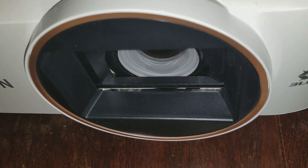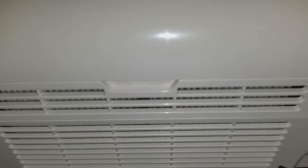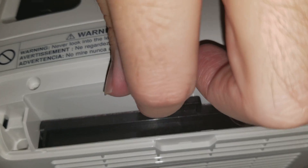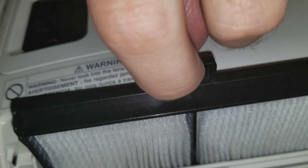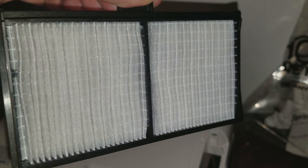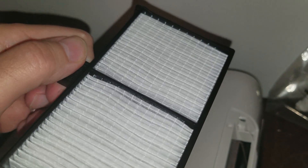The light bulb is here and it blows hot air, and this is your filter. On the Epson, it's very simple — all you have to do is pull this part right here out, and you will see there's a filter right there. You just slowly and gently pull this filter out to see if it's dirty. As you can see, my filter here is clean — there's no dirt in there. I take care of it and clean it all the time.